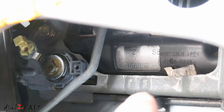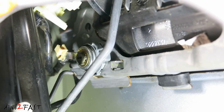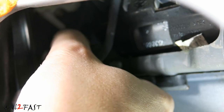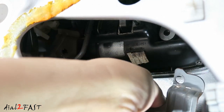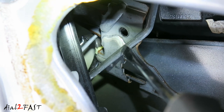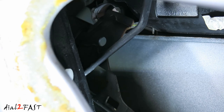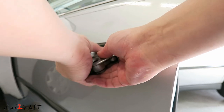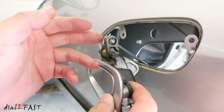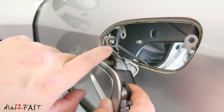Here's a look with the clip off — that's what that clip looked like. Now go ahead and remove the two 10-millimeter bolts holding this bracket. From the outside, you can push the lock cylinder out and carefully remove it. Now remove the bracket. There's a wiring harness with a plastic clip holding the bracket in, so release that clip and the piece will come out — I'll use a long needle nose for that. With the outside door handle free, pop it out. There's still one more connecting rod to disconnect. Note that the plastic piece holding this connecting rod is essentially a one-time use — once you pop it out, the clip will be damaged, but that's okay because a new handle comes with a new clip.